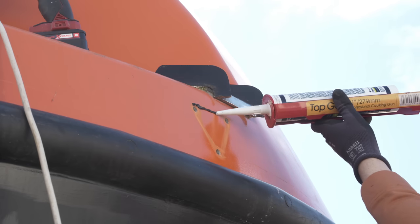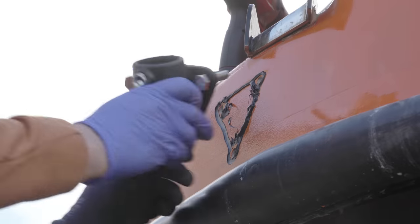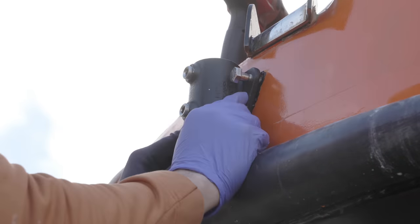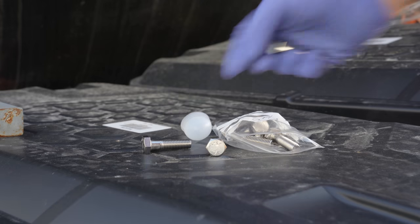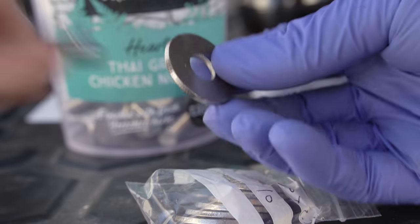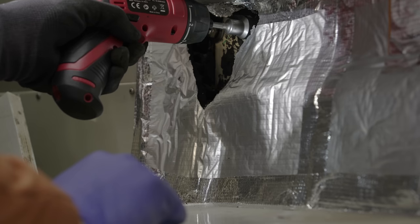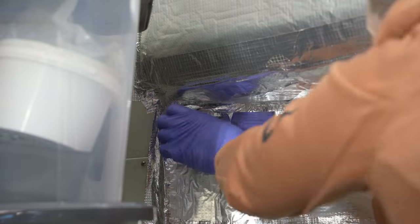Now for gunge. My favourite Boss Sikaflex for something serious like this, and I'm careful to make sure there's a good seal around the edge, the holes, but also around the top of the bolt thread so water can't creep through. We have success on the outside, but that leaves the inside. I've removed a small patch of insulation and added those extra thick washers to get a really wide, strong clamping force. Very happy with that, and then I patched it up.